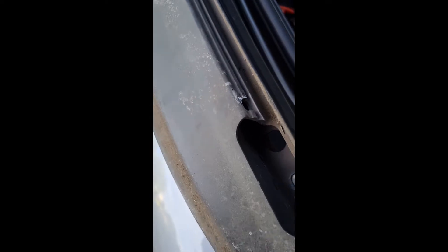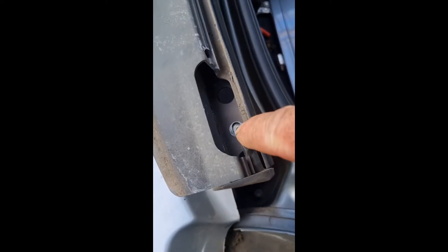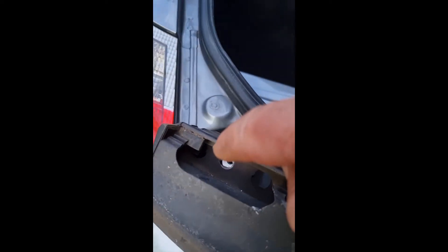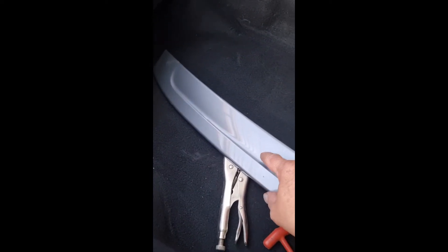Now for the rear spoiler — we need to take the spoiler off to get to the screws at the base of the spoiler. With the boot open it's a lot easier. There are two cap screws which sit in this hole, so we just need an allen key down on top of those to undo them — one on each side. This is underneath the cover once you've removed it, which is just clipped on. Early cars have some little plastic plugs; later cars have just a trim that hooks into the back end first and then clips forward. Once you've got the spoiler cover off, two screws underneath, and the spoiler literally lifts off out of the way.